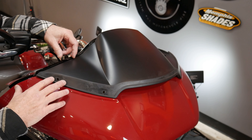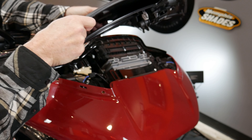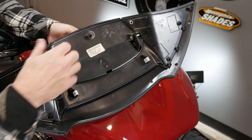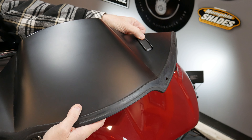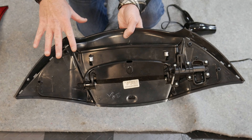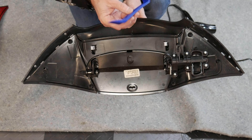Pretty simple installation. We took the four screws out, removed the windshield, and then this is just going to pop off. I'm going to be reusing this gasket that goes around the front. We also have to pop off this mechanism that operates the vent inside with this little actuator here. To get this actuator off, there's 3M tape in several locations from the factory. I'm just going to use a hairdryer and heat that up. I've already got one side off. It might help if you have one of these little pry tools — you can buy these pretty cheaply on Amazon.